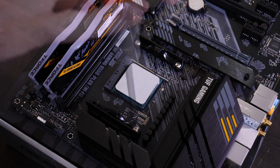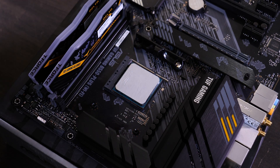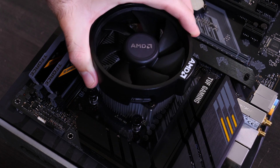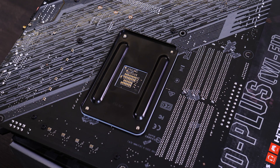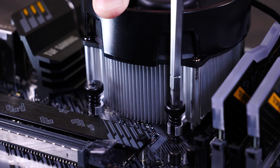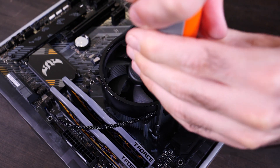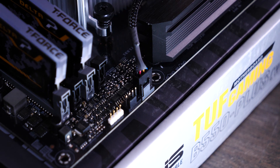With that nicely applied, I'll secure our cooler to the CPU. We'll line the heat sink up with the CPU and gently place it on top. The CPU cooler is held in place by a plate on the rear of the motherboard. Because the screws on this particular cooler are spring-loaded, you'll need to apply a little bit of pressure in order for the screws to make contact with the plate. After the cooler is secured, I'll plug the power cable into the motherboard's CPU fan header near the top of the board.